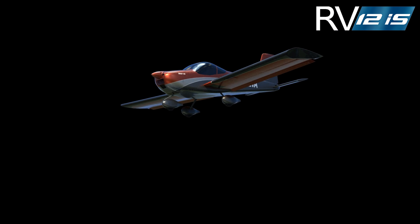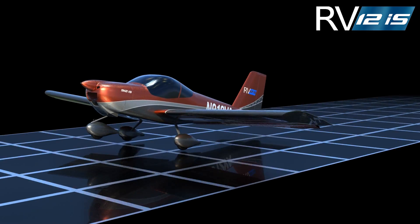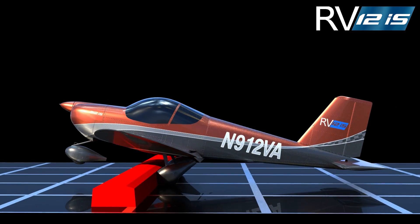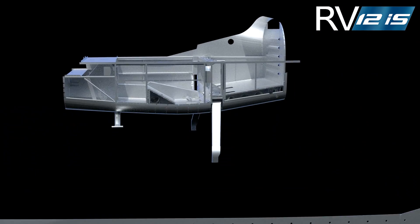It was a test simulating, at gross weight and full fuel, an impact of the main gear with an immovable object such as a berm or a curb. The gear would fail, but would the failure deform the gear support structure to the point that the fuel tank would be affected? With this in mind, the gear support structure was designed to take a greater load than the gear attachment bolts.